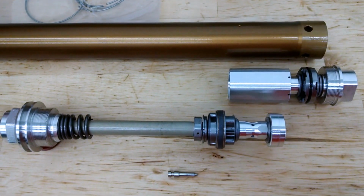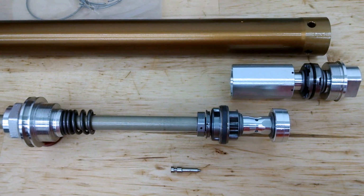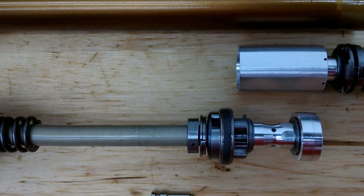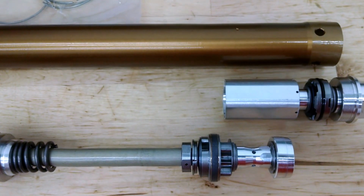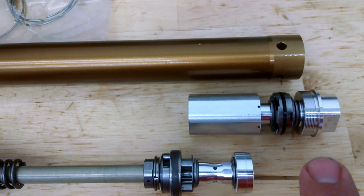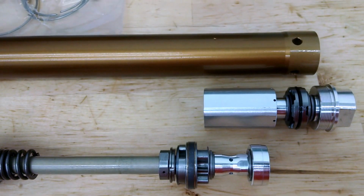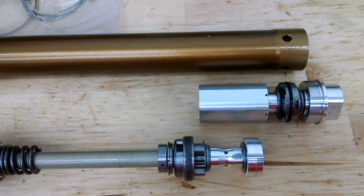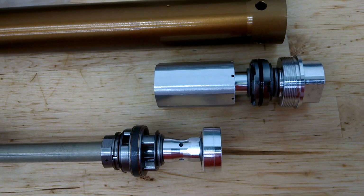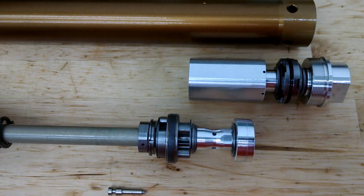And let's say the coefficient of performance is pretty low from an expectation standpoint, and so all that stuff can be managed. The big thing is, of course, you've got to change out the mid-valve pistons, and all the things that people are kind of used to doing. So we add in an adjustable base valve. It's adjusted via a 4mm Allen head, and that's really nice. Again, no slip on the screwdriver, all that kind of stuff. But that also allows us to really improve the pressure balance of the system, which is a key point to making this whole thing work.